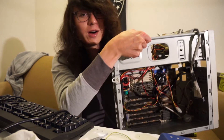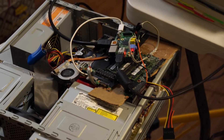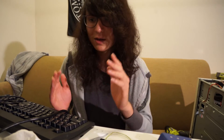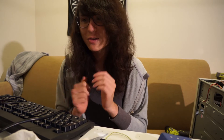It was the fact that you're going to need a 3.3 volt power supply to power it, because most of the time you can just use the ThinkPad power supply plugged into the motherboard and it'll power the BIOS chip, or use the 3.3 volt rail on the Raspberry Pi. But for some reason on the X200S this does not work, and me not knowing that and not being skilled at soldering, I just thought my soldering job was messed up.